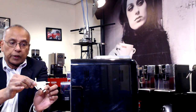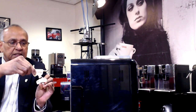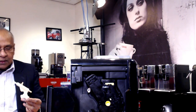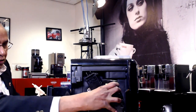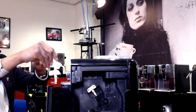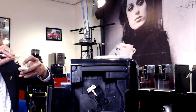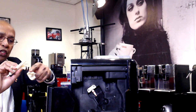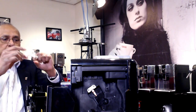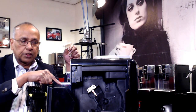This valve goes into a little fitting that connects to the brewing unit. You can actually see this part if I remove the door — here is the brewing unit that comes out, and here is that little outlet valve. The water has to push through this particular section, which is quite a delicate part with a spring and a valve that requires a lot of pressure to flow through. Make sure that part is kept clean by doing a descale on a regular basis.